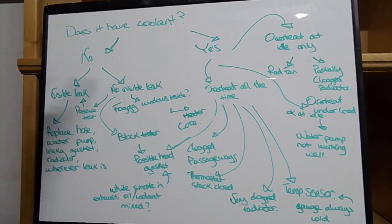If it has a coolant leak, you can add coolant. If you don't notice any leaks, add coolant and run it for a little bit to see if the coolant level drops again. Sometimes the cooling system just has some air bubbles trapped in it and a previous person didn't bleed it properly. So you can just add some coolant, drive the car around, see how it does. And if it's still leaking, go ahead and look into it further.